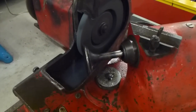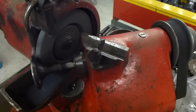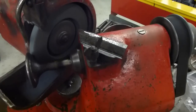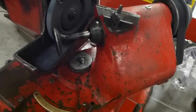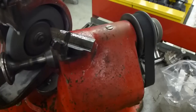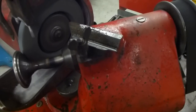There was no cutting then, so we moved the Y-axis in — we want to go very carefully, just a few thousandths at a time. We're just making contact now, and you can see we're slowly re-cutting the valve face.